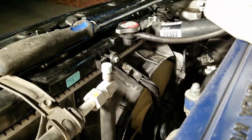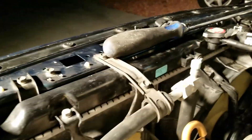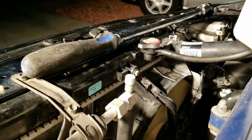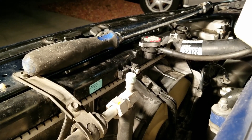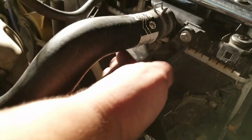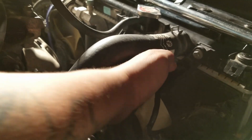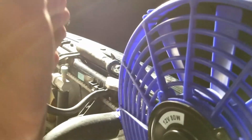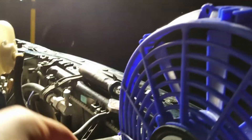With the car off you can see it was spinning counterclockwise. Now to check the new fans: if you notice, the fins are angled diagonally facing the driver's side of the car, not the passenger side. The DNA fan fins are facing the same direction with a slight slant toward the driver's side — so they match.